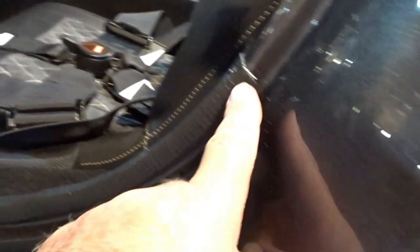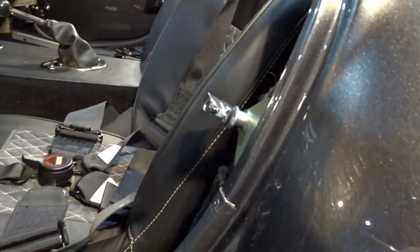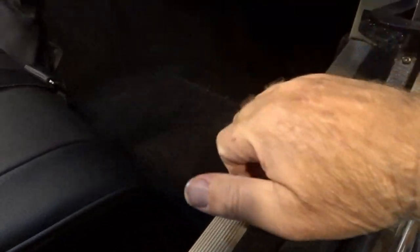I've got the latches adjusted one more time because a lot of times this molding that goes on here to finish off the edge will keep the door from closing the same distance as it did before - but that closes nice now. The other side is done as well. We did this side the same way: wrapped the carpeting around the piece, pop-riveted it in, then folded the carpet over and added our trim piece and finished molding on the edge of the door.